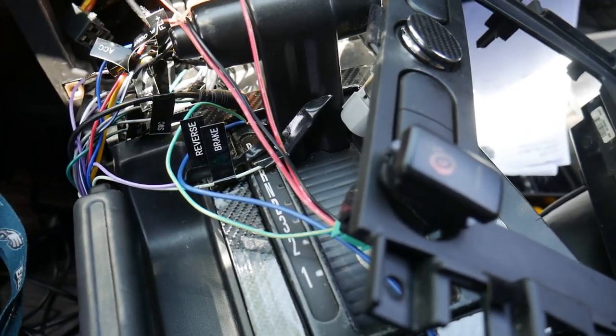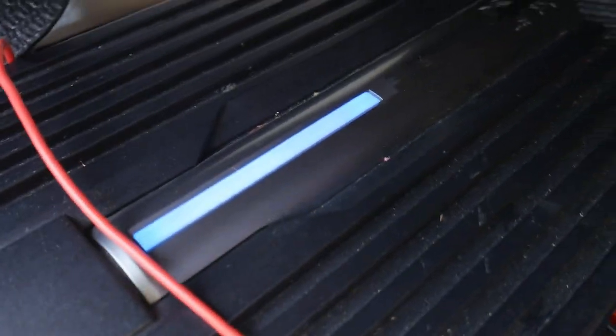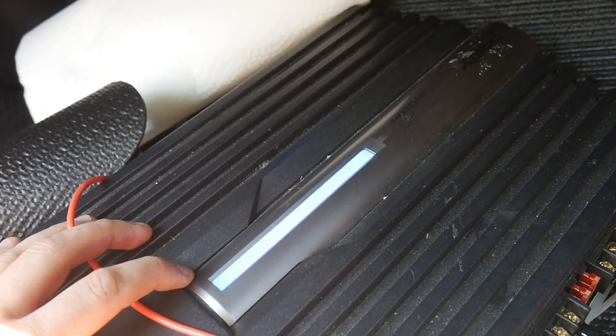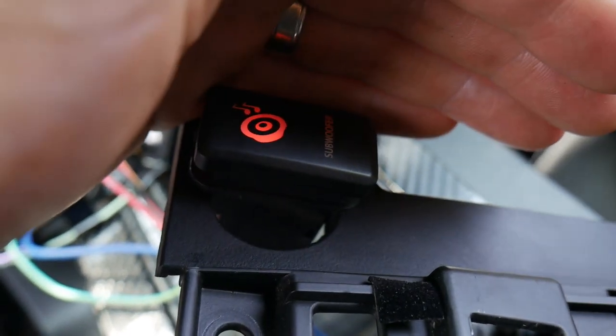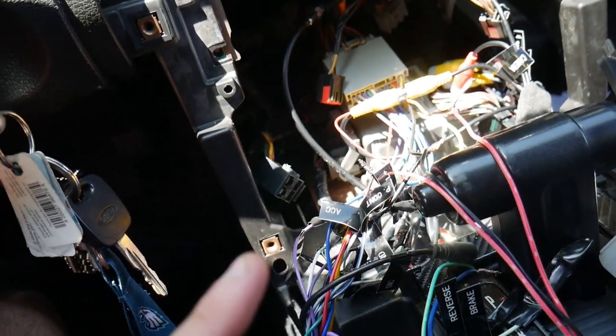Actually we probably don't need to connect the radio — let's go see if the amp is on at all. The amp was not on, so let's press the button down and go see if the amp is on. Wow — the amp is on! Can you guys see the blue light? Holy cow, I basically just guessed where the wires should be connected for the new button and clearly it works. We'll turn it off — so just by pressing that button it turns off the subs and the amp. Let's go ahead and electrical tape everything up, connect the radio, and test.